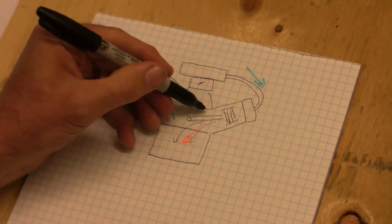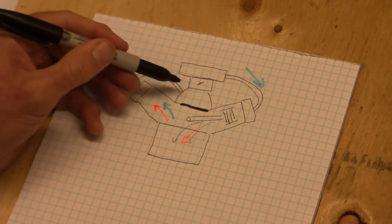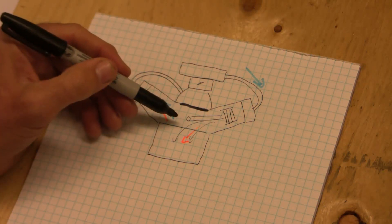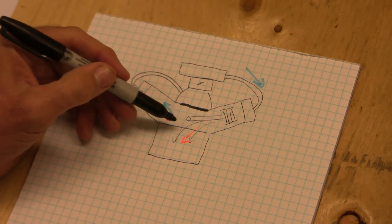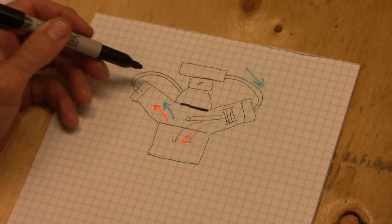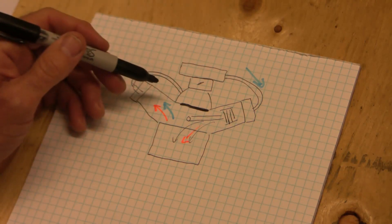Now look at this. The plenum pan is right here, with manifold vacuum above and slightly positive crankcase pressure below. The way this is designed, if the pan gasket fails, vacuum leak from above usually draws crankcase vapors into the intake manifold, short-circuiting the PCV. Of course this really matters when the PCV would normally restrict flow at idle, so it's not surprising that poor idle is characteristic of a vacuum leak.